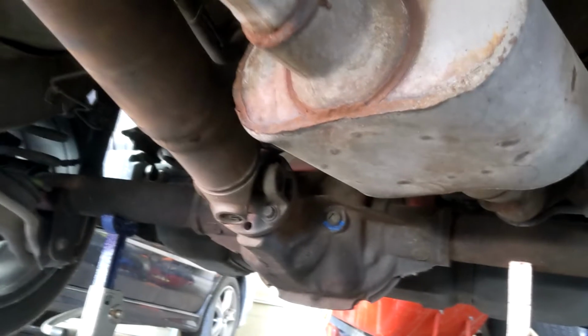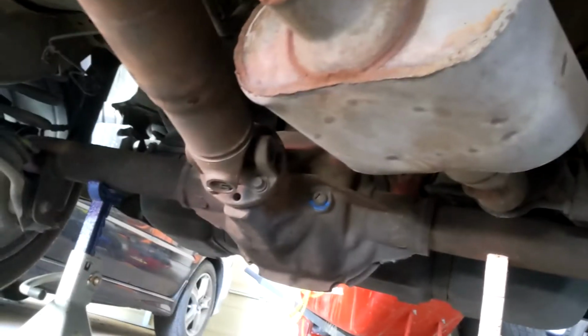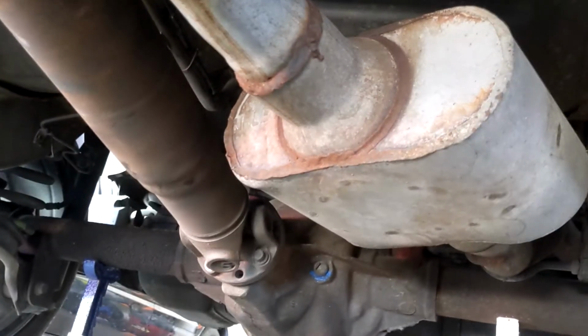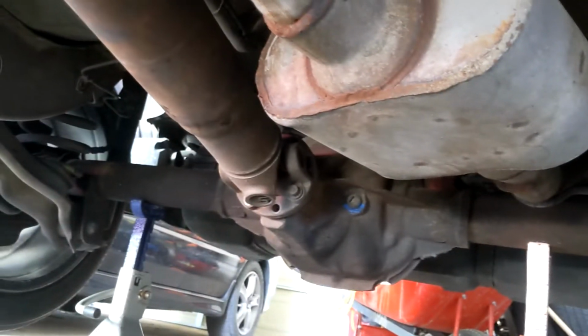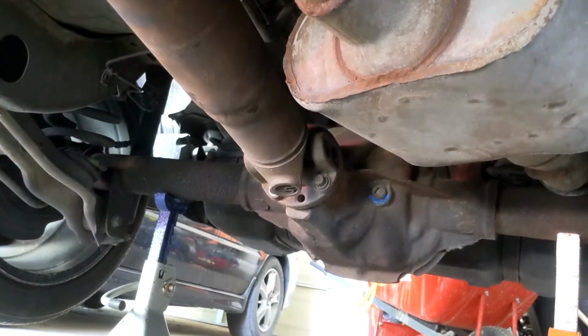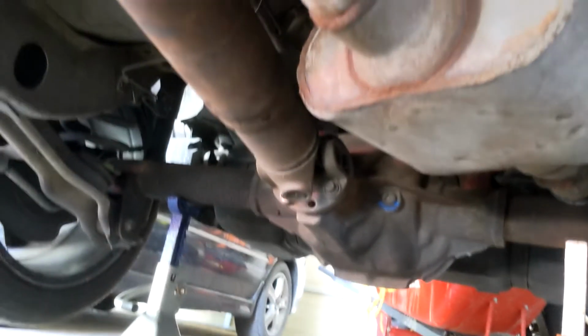My e-brake is on all the way, and none of my wheels on the outside turn. But if you look at that, it looks like my differential might have a lot of play in it. I'm pretty sure this axle won't make it through to the drifting phase. I'll definitely have to swap in an 8.8 out of a GT Mustang with an LSD. I was originally going to weld the diff, but I don't think that's going to happen.